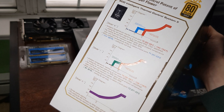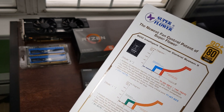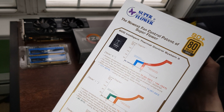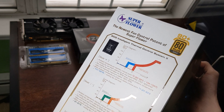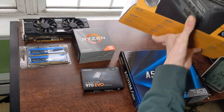With a lower efficiency power supply there's more heat, so it needs to ramp the fan up higher. If you're using 200 watts at 90% efficiency, you're going to be dissipating 20 watts of heat. Whereas with 80% efficiency, which is what the lower ratings are, you'll probably be dissipating 40 watts of heat, and at a higher load, double that. So it's a lot more heat that the fans need to blow out.